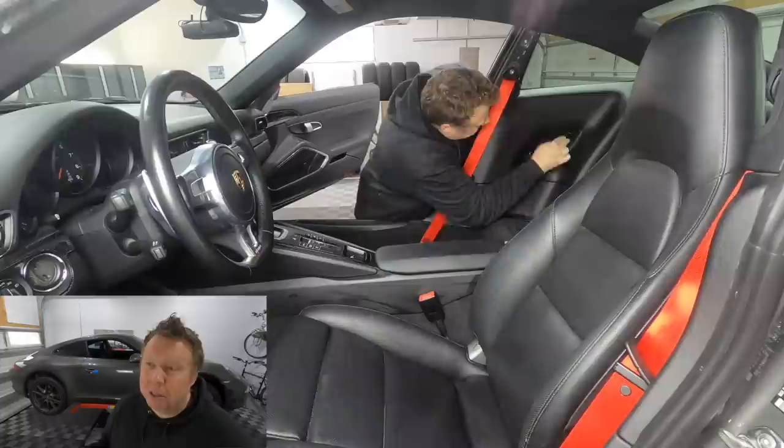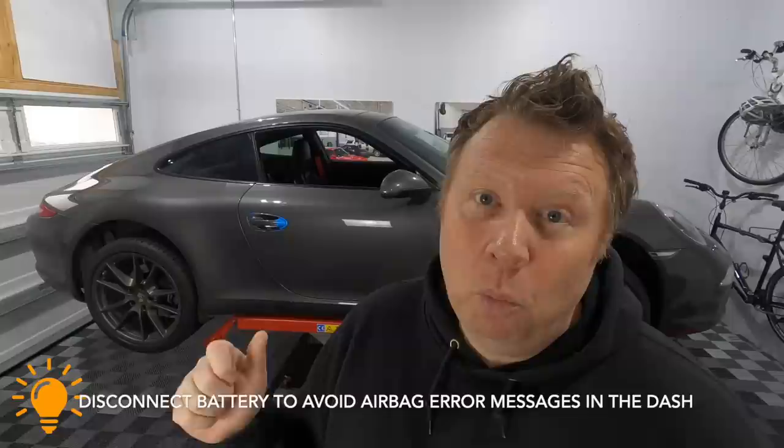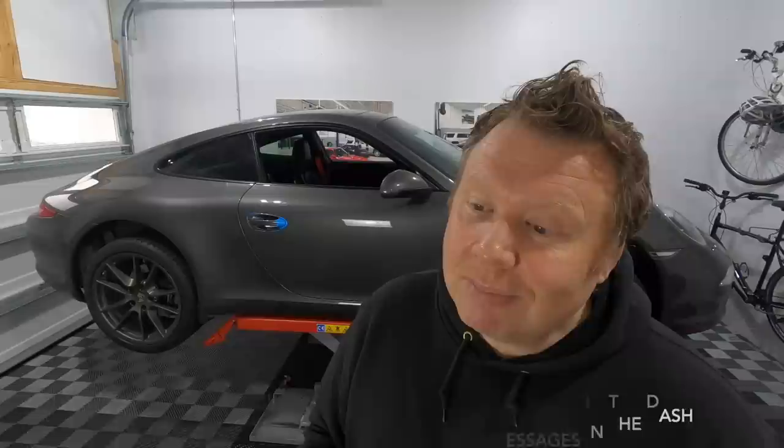Now, one comment I got on the first video from a lot of people was asking why I didn't disconnect the battery. From what I understand online, you can get airbag error messages in your instrument cluster, which you need to have taken away if you go to a Porsche dealer or a friend that has one of the aftermarket Durametrics to connect in and remove the codes. So that could be a trip to Porsche.